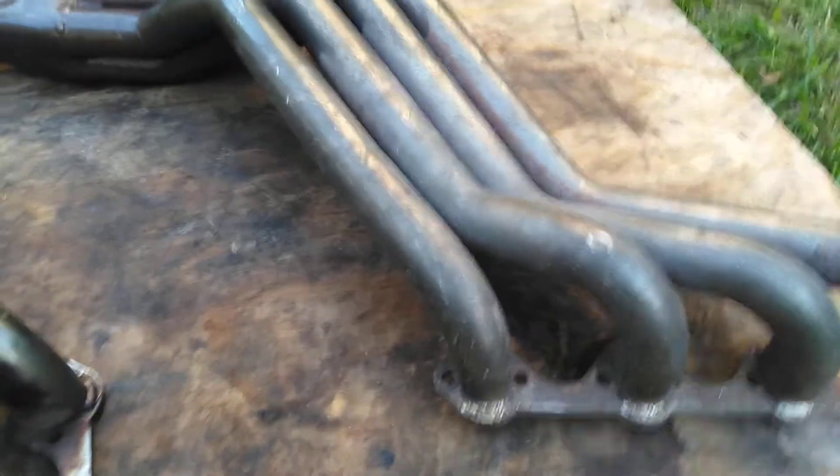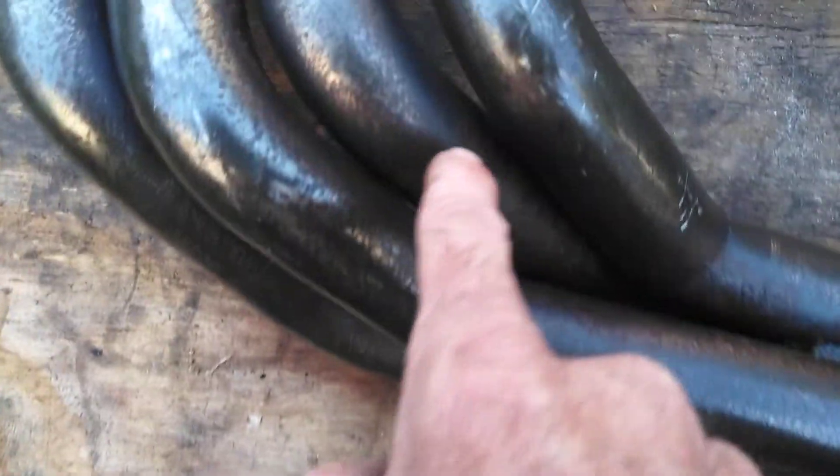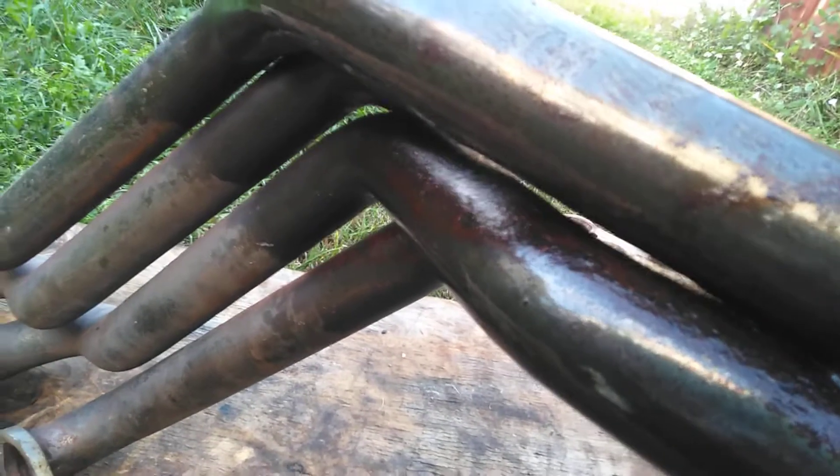With these BBK 351 headers, the issue is on the passenger side — a lot of headers will rust up under here or in the seams. That was the case on this one; it had rusted up in here and I used a flathead to scrape it. I haven't scraped this tube off yet on the inside, but I've scraped all the other tubes. You can see it's rusted in between there — nothing to get your panties in a bunch over. I'm going to clean that rust out and get this prepped and ready for high temp paint.